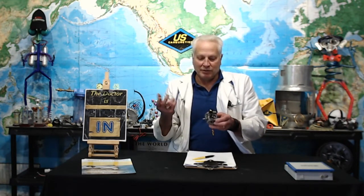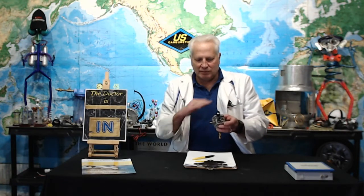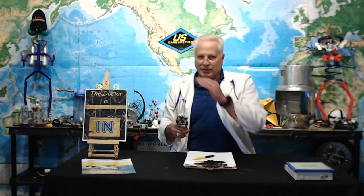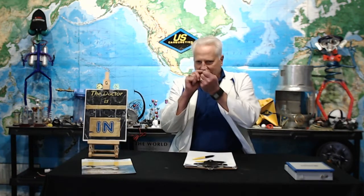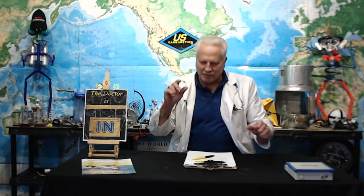And then to clean them, you can take a drill bit, especially a step bit like you get from Harbor Freight, and just clean up the top a little bit, smooth it out. It'll be a nice straight cut, because you want a straight cut. So absolutely, if you got a slip tube kit and you feel the tube is too long, or you're one of those perfectionists who really likes it up tight against the bottom, no more than one third sticking up in the airstream, absolutely feel free to cut it.